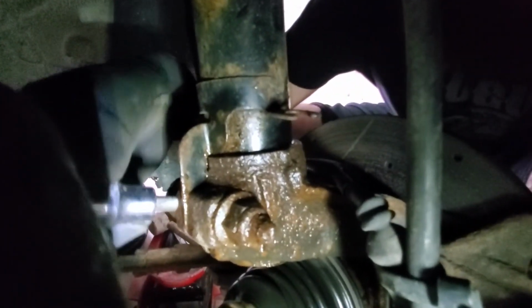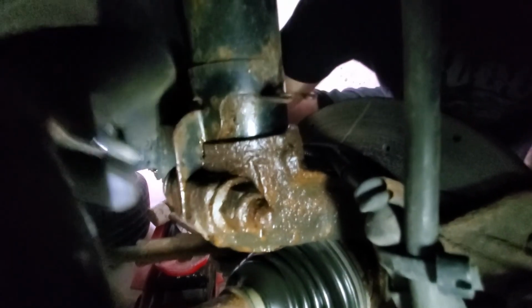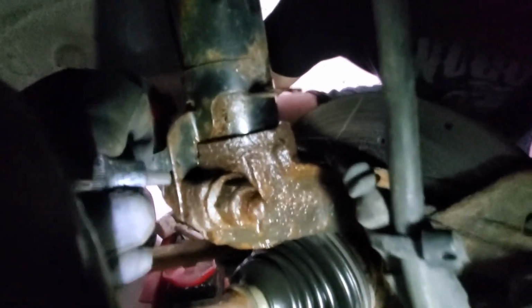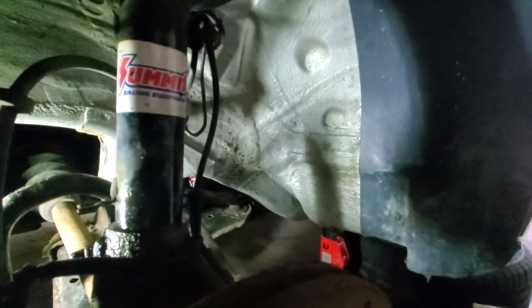And you're gonna want to get yourself one of these. It's a strut spreader for European cars. This will go in one of these cracks here. Once this pinch bolt is removed, it'll go in there with a 1/2-inch ratchet, and then you'll turn it and it'll spread the strut housing thing, whatever you want to call it.